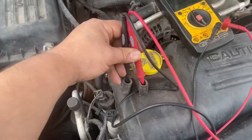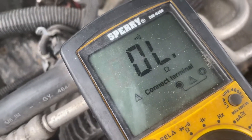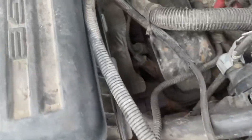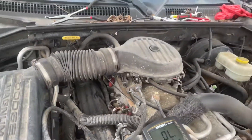We're on both ends of the coil wire using a simple multimeter test — there is no continuity between the wire. The wire is blown. Bad coil wire confirmed. But we're going to go ahead and give this baby a tune-up.